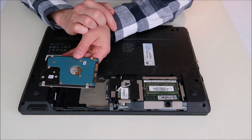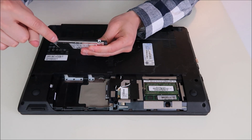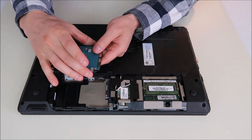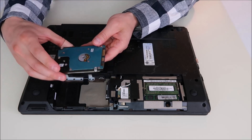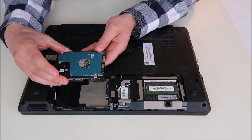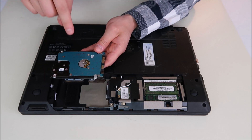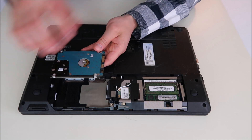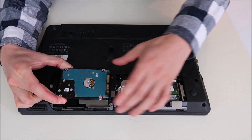The orientation has to be correct. When you take your hard drive out, you're going to unscrew these four screws on either side, and that will release the hard drive from its caddy. When you go to put the hard drive back in, make sure that it's secure in its caddy. I'll have a link below in the description on another computer that actually had a caddy. Once you get your hard drive into the caddy, you'll just slide it back into the port and then screw it down.